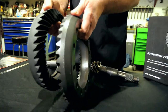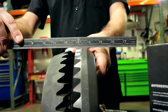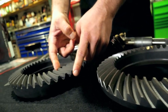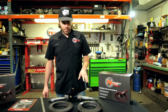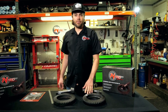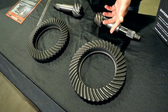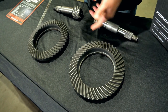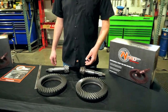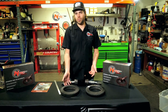As you can see, there's quite a bit of difference. We've got a quarter inch difference in the actual outside diameter of the gear set, but as I mentioned, a 10% increase — about 150 thousandths versus the normal Dana 60. There's nothing wrong with the Dana 60 design as it was; we just were going to be developing a new product, something to make it better. We use the latest greatest design with a 10 inch ring gear. On your late model vehicles that have the Super 60, you don't have to downsize to the nine and three quarter inch ring gear, and this can also be fitted to any Dana 60. So if you have a '79 Ford Dana 60 in the front of your Jeep that you swapped in, you could put one of these in it and pick up some extra strength over a standard Dana 60 gear.